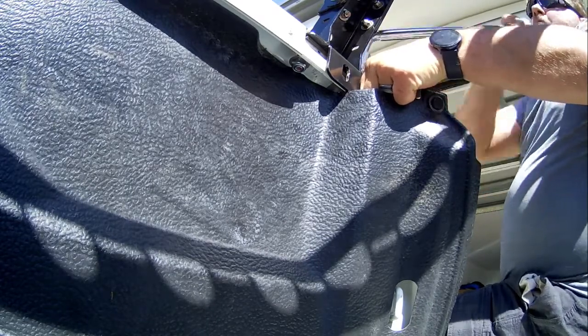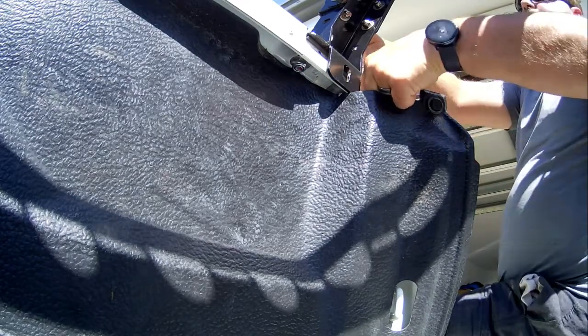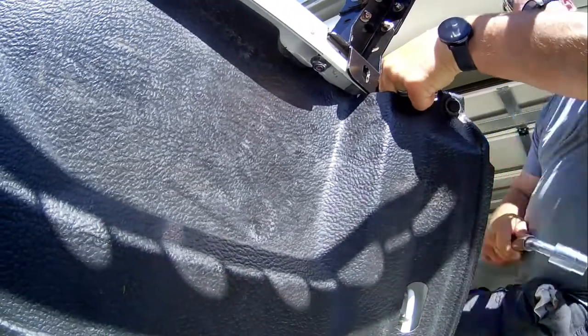And you can see this is now the back right. I actually had to pull out the tub liner slightly in this corner because of the lack of room. I couldn't get the Allen key in there, so I had to pull my tub liner off slightly to get my Allen key underneath to tighten that bolt up. Fortunately it just sticks back down, it's all good, but it's something to keep in mind when it comes to installing yours, when you're placing it on and drilling your holes, making sure that you've got the space that you need in that area.